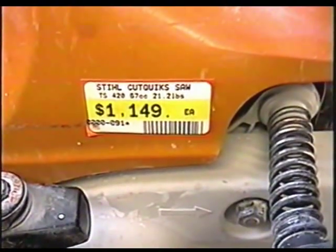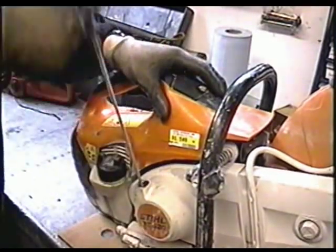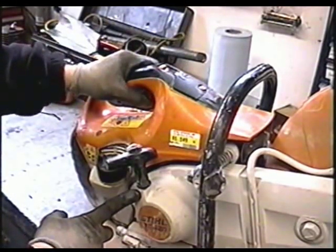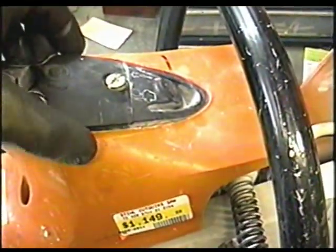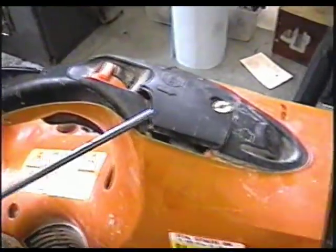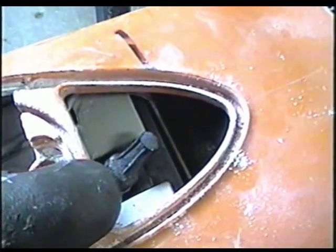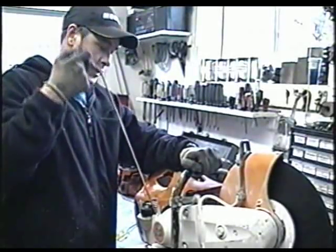Here's what a new one costs in Canadian dollars. So it's really easy to pull, and that's usually a sign of a blown top end, meaning the piston rings and probably the cylinder as well. Now before writing the saw off, take this little cover off here, take the little rubber off, and make sure that the decompression valve is pulled out all the way. If the valve is in the open position, all the air is going to escape out of the engine and you're going to think that you have a blown top end. So the valve is pulled up — I'm going to try it again — and it's still easy to pull, so I know there's a problem in the top end.